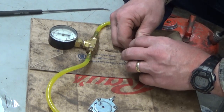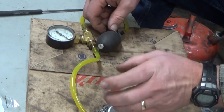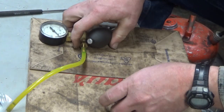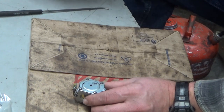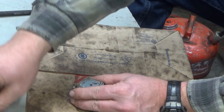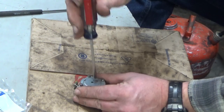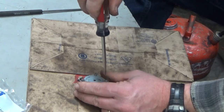But you don't want to disassemble this end under pressure, especially if there's a risk of fuel being in there, because you get it apart and it'll try and blow fuel at your face. Not the most ideal thing on the planet. This is a fresh K10 HDC kit here, so anything that we find in here that's bad, we'll be able to replace.